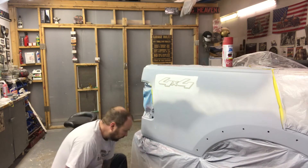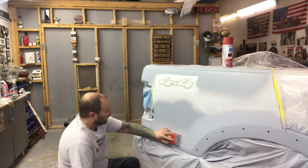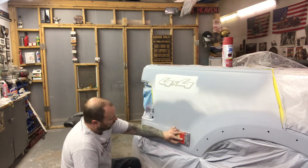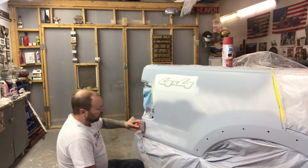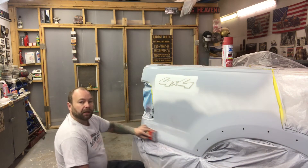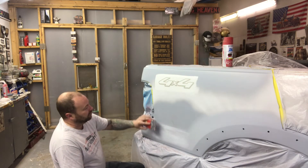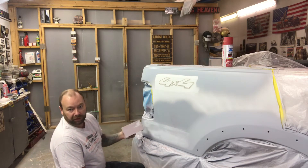Alright, we're going to start blocking. First you want to keep your block nice and flat. I'm starting with 220 grit sandpaper, and with prepping there is what they call the 100 grit rule. We're going to go with 240 to do the initial blocking, then I'll switch to a 320 grit sandpaper for finishing, and then the final stage will be 400 grit. In this case it's a solid white color — 400 grit is fine for finishing. If it was a light metallic I would go to probably a 600 grit.